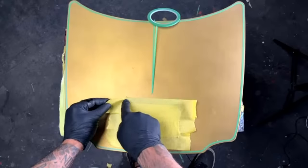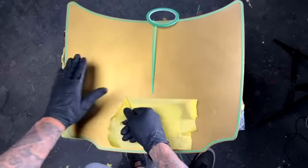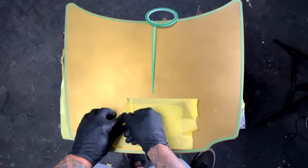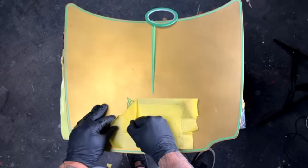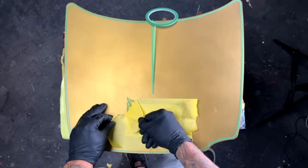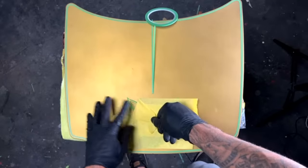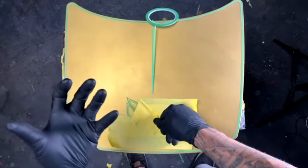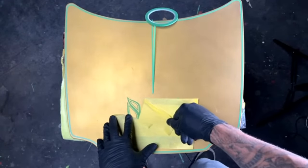The only time I really did have success is when I laid them over clear coat and sanded it smooth, so that way it had good contact. And then when you're laying down your first coats of clear, you have to go super light because you don't want the product, like the urethane, getting into that sticker, getting underneath it. So dry dust coats to get the buildup, and then you can start adding a little bit heavier coats.